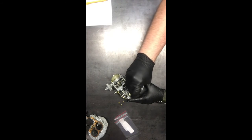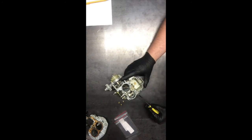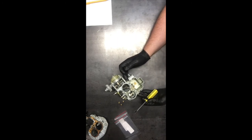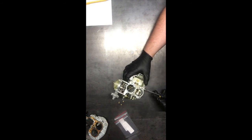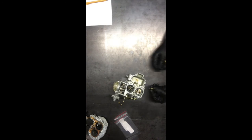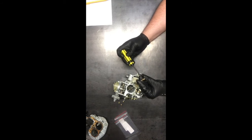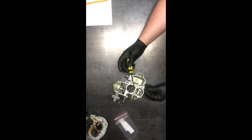As far as I've researched, the emulsion tubes that come in these carburetors — we don't need to do anything with those. We may need to address air leaks at the idle jets. There are recommendations on putting an o-ring at the base of the jet holder, right there. I'm going to test it out as it is and just see what it does.